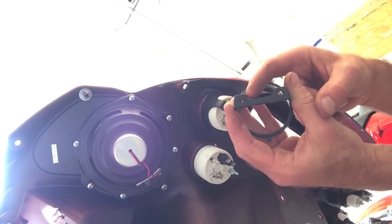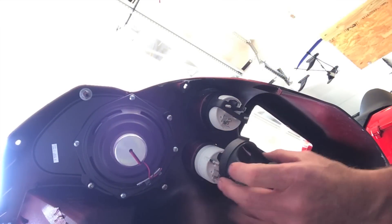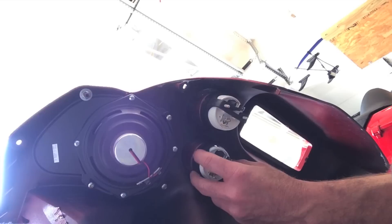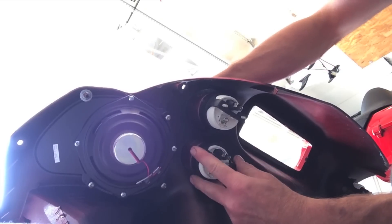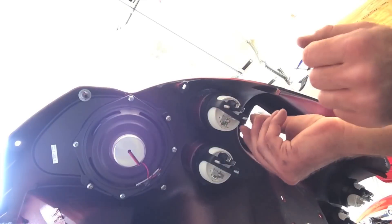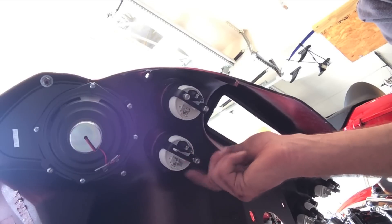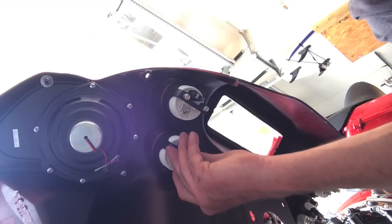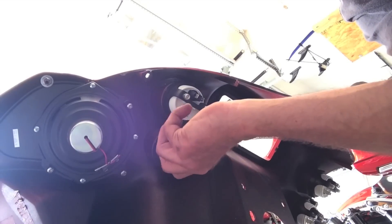Right now I'm just putting in the gauges. I already put the speakers in, and I'll fasten the gauges on the back side. These are indexed — they have a notch out of the top to account for where the leads come in. They also have tangs on here which help index the gauge so you get the rotation right. I'll slide it on there, make sure it's seated, and come in from the front to line up these screws and seat it. Now they're all in there, indexed and ready to have the nuts put on. I'm actually surprised these don't have any Loctite on them, because pretty much every other bolt and screw on this bike does — to keep it from vibrating off. But these just go on here; snug them up and I'll hit them with a wrench.